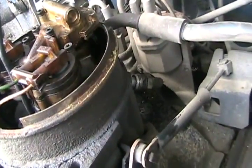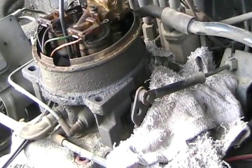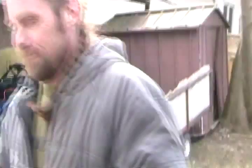She's already dribbling and bleeding — perfect. I've got a rag stuffed there so I don't have to bend the fuel line to catch the stuff that's going to come out. Turn the key all the way to the run position just for a second — I want to see if the fuel pump powers up.